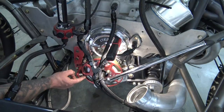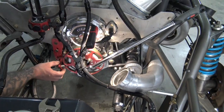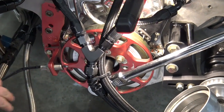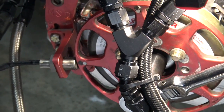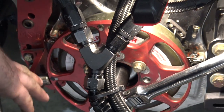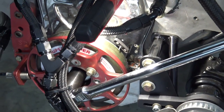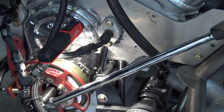I like to set them up on the falling edge. So what you want to do is move this sensor towards the bottom of this magnet, kind of off the trailing edge of it. Get it close, then shoot it with a timing light and adjust from there. That's the difference between falling edge and rising edge. So once we have this set at 60 degrees before top dead center, we now have to set our cam sync into 195 degrees — basically 135 degrees prior to.